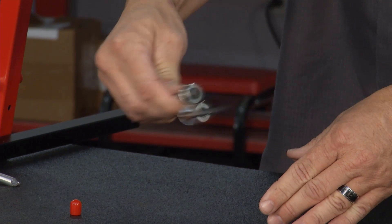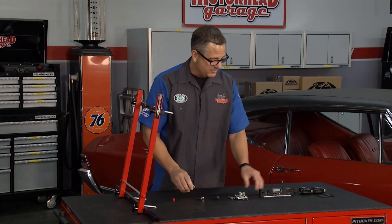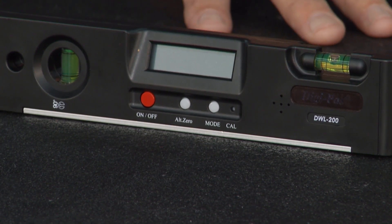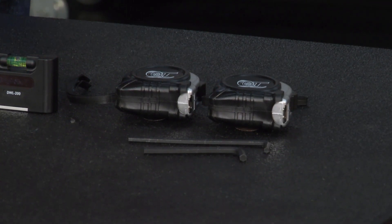You can see I can fling it around and it's not going to come off. I can clip it on there in seconds and it's going to stay put. It comes with the magnetic system for measuring camber and caster, which is really nice, and they give you the tape measure. The tape measure goes across the front and the back of the vehicle for toe, and all the wrenches you need.